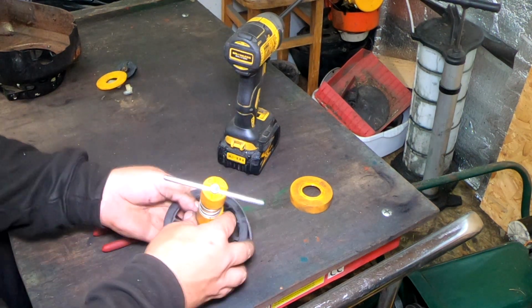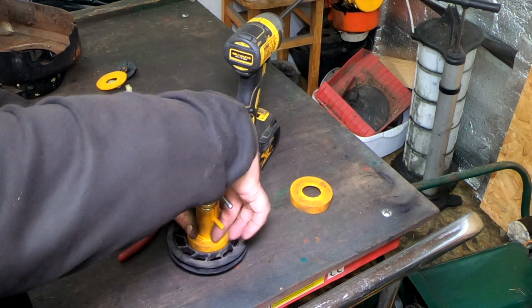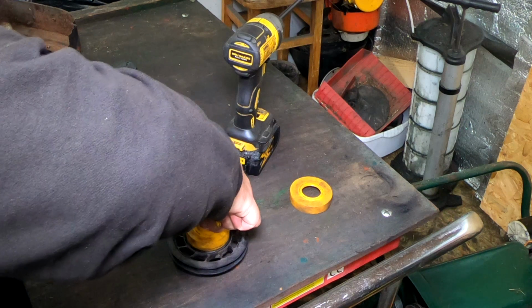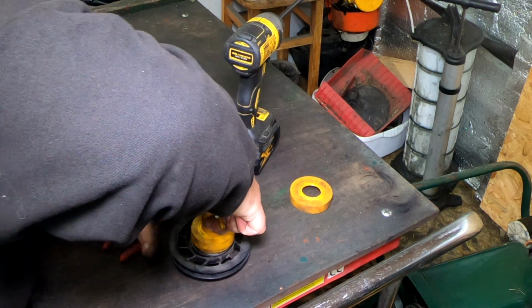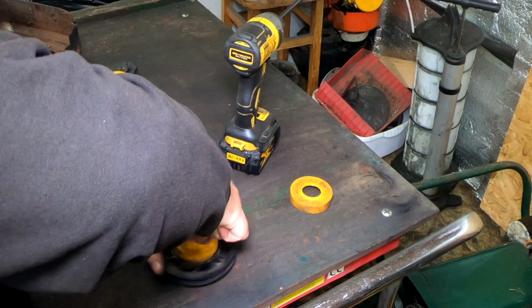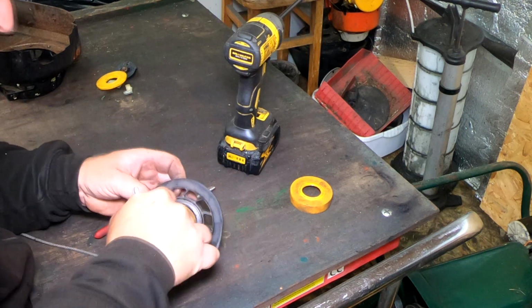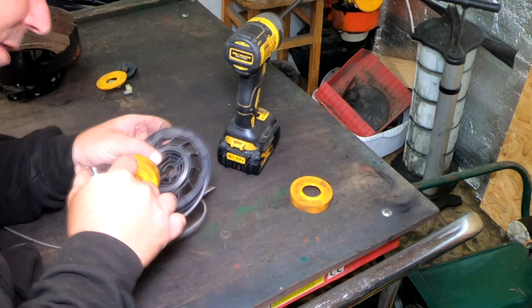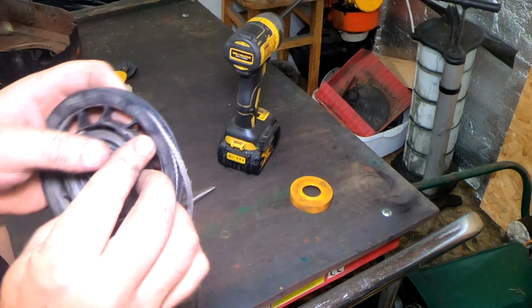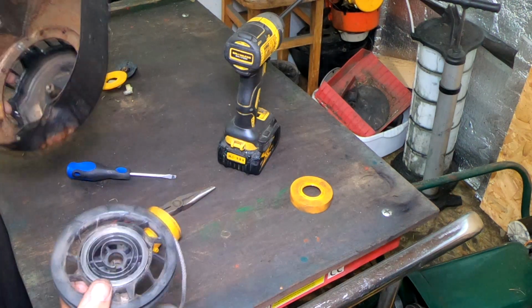Once that hook's in place, put it down, eject it by putting these two together. And hopefully, God willing, take the tension out a bit. It got caught up there somewhere. Keep going. We're nearly there. Here it goes. There is your Briggs & Stratton recoil spring, all fitted in, into place. Just want sitting down. There you go. Perfect. There you go.